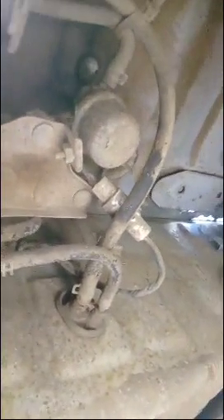The diff bush flogs out — this one's fully flogged out. The rear diff will always leak a tiny bit but you don't want very much. This one looks like the pinion leaks just the smallest bit. Underneath they're very simple. The fuel pump lives back here — sometimes it lives in the engine bay. Check all your hoses because they don't last forever, they're only made of rubber, and they're cheap to replace for safety's sake.